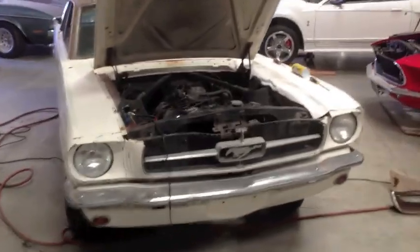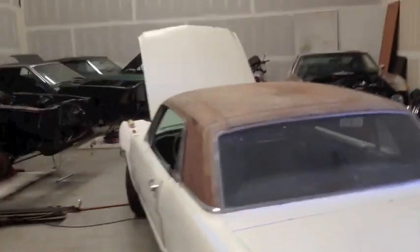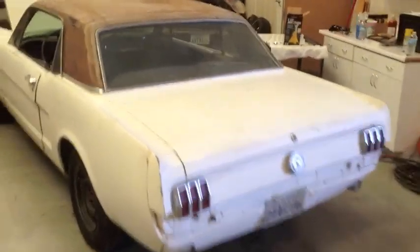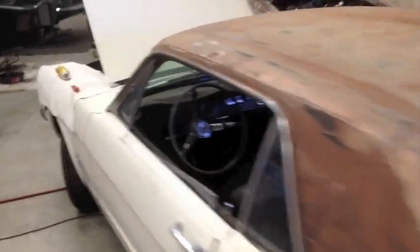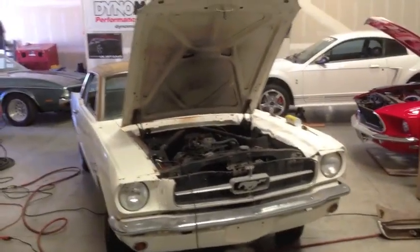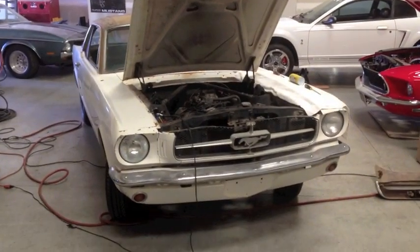Battery was dead on the 64 and a half today, so I'm just gonna let it charge tonight, and then we're gonna revisit her tomorrow. But we know we got fuel all the way up to the pump now. Now we just gotta see if we can get this pump to kick in and start to suck fuel. If it doesn't, I'm gonna recommend getting a new fuel pump for her, and we'll see what the client wants to do. He does want to drive her down the road, but it still needs a number of parts to make that happen safely.